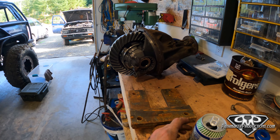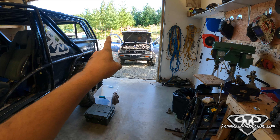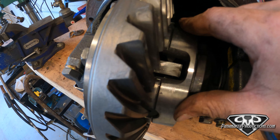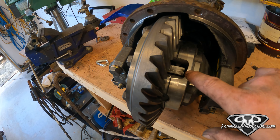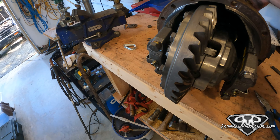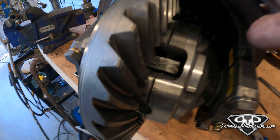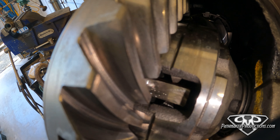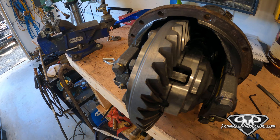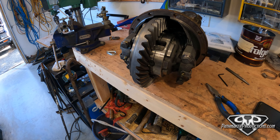It's officially beer-thirty, which means I'm taking longer than I was supposed to. Also fun times — while I was laying underneath that thing, key not in the ignition, I heard the fuel pump kick on twice. So I disconnected the battery. Probably why the battery keeps dying. Anyway — that piece of three-eighths flat bar cut one and a quarter by a half inch fits absolutely nice and tight in there. Can't even spin the spiders right now — that is exactly what we want. I'll cut three more of those, smash them in nice and tight, and then fire up the sparkle machine.